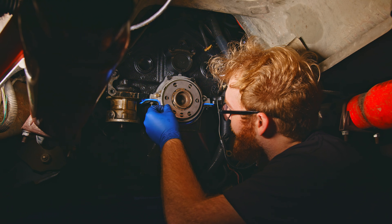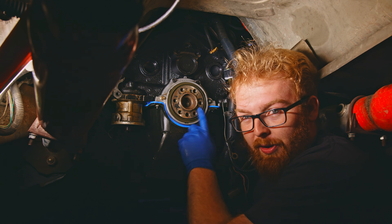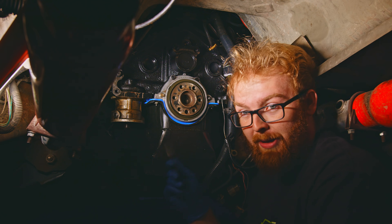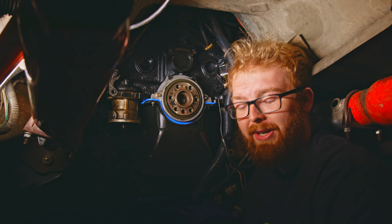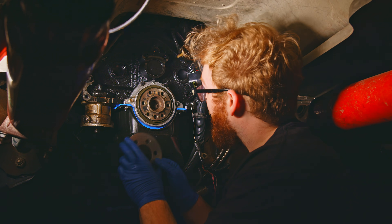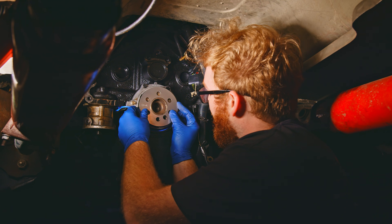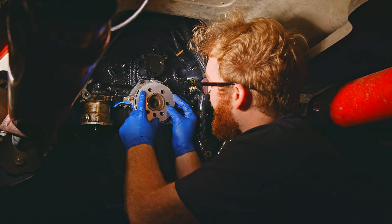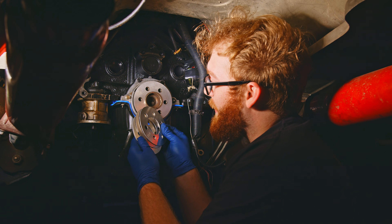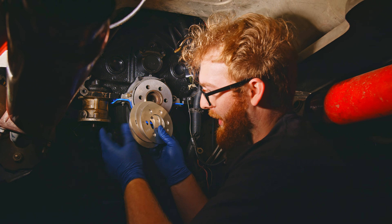This shim does not line up at all with this crank. That might just be because this is not the crank that came with the engine — it is a stroker crank to make our 350 a 383 — but I did buy two packs of shims, so I'm going to go grab the other pack and see if those fit. Hopefully they do, or else we have to wait a few days for the next ones to get shipped in. Let's see if this other pack of shims lines up a little better. Yes — I can see that all these holes actually line up with the crank. These are different thicknesses though, so we just need to measure these out and find what is equivalent to close to 180 thousandths of an inch.